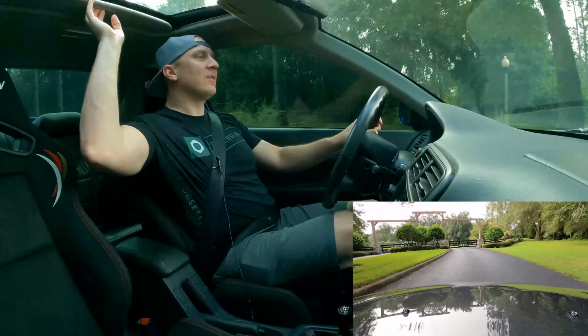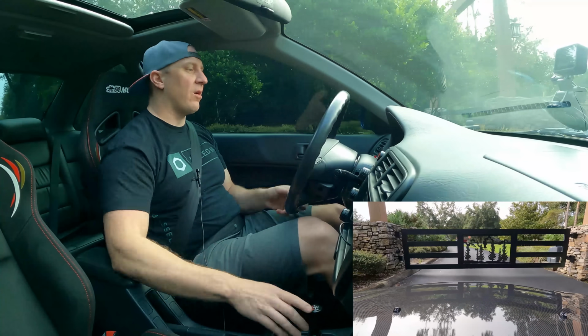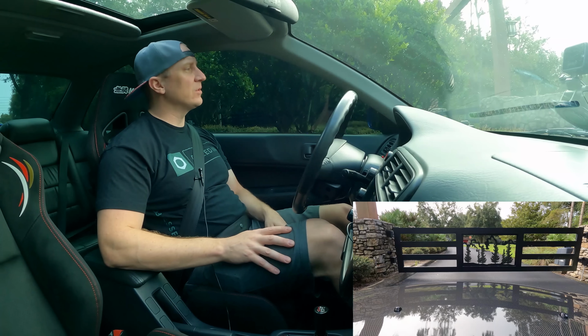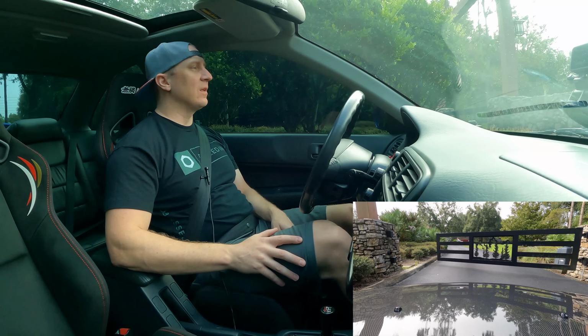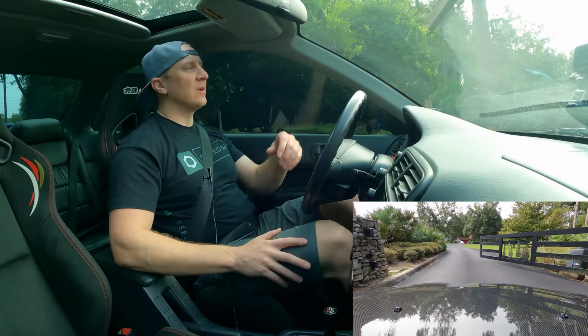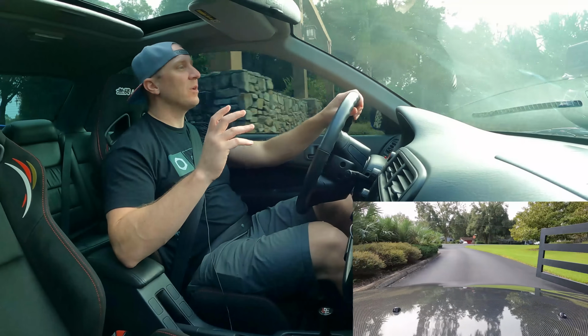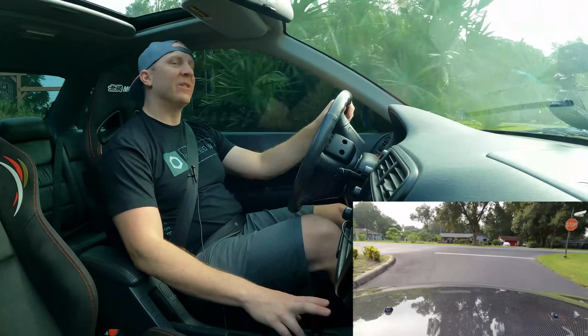That's a new one. So anyway, Moton 3-way, all the hard brace stuff. I haven't done the roll center adjusters yet. I don't know that I'm going to do them because that might actually raise the top of the upper control arms up too high. So I don't even know if I want to mess with it because everything feels pretty good outside of the crazy steering ratio in this car.